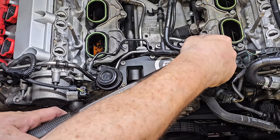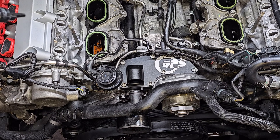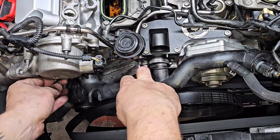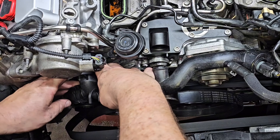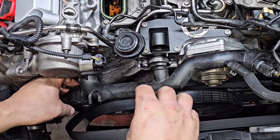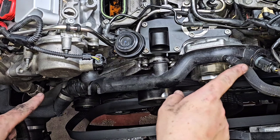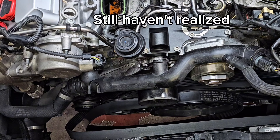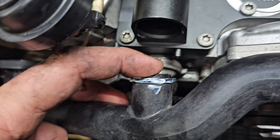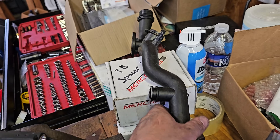Go back over everything twice because as you tighten they do have a tendency to loosen up. Next, install your replacement gaskets on the crossover pipe — set them in there, don't force them or damage them; they should fit nice and snug. Before seating it to the engine block, reach in, grab a little bit of coolant, and rub the outside of the gasket. Do that on both sides. One thing I just noticed — this pipe is broken; there's supposed to be another part here. Thankfully I have a replacement.